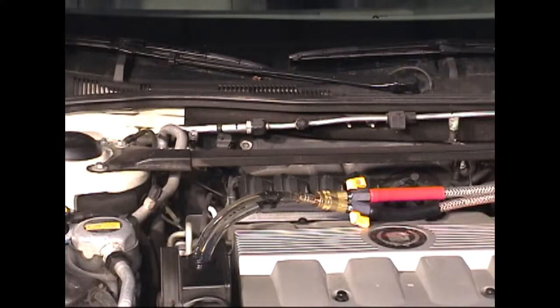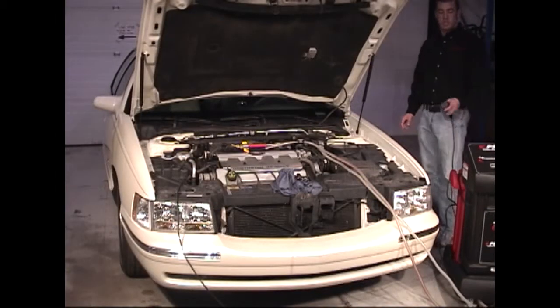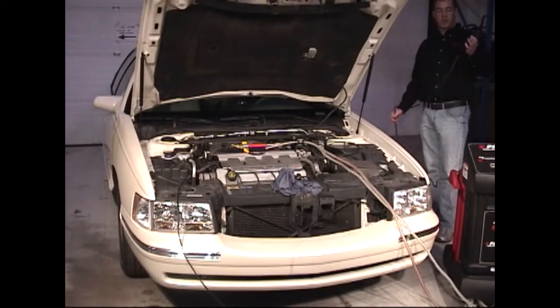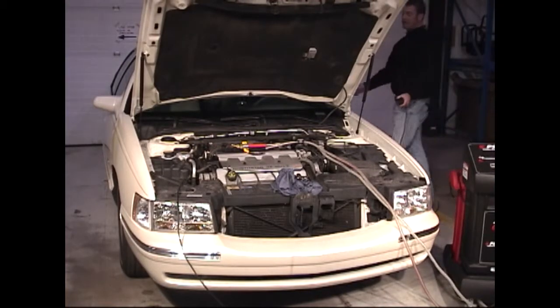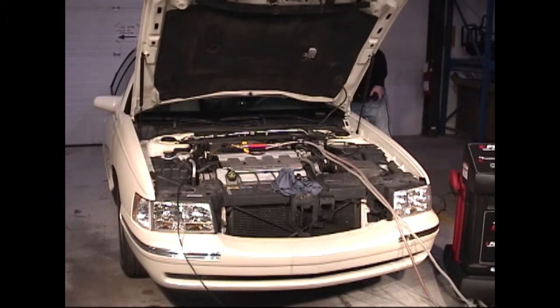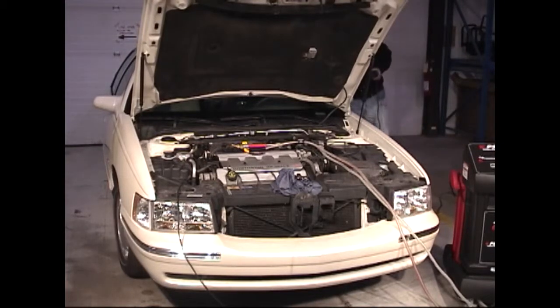When the fluid in the reservoir looks to be running clear, the vehicle can be started and the wheel turned from lock to lock to circulate any other used fluid. The PSX 3000 machine is supplied with enough cord on the pendant that a single user can reach back inside the car, start the car, and turn the wheel from lock to lock